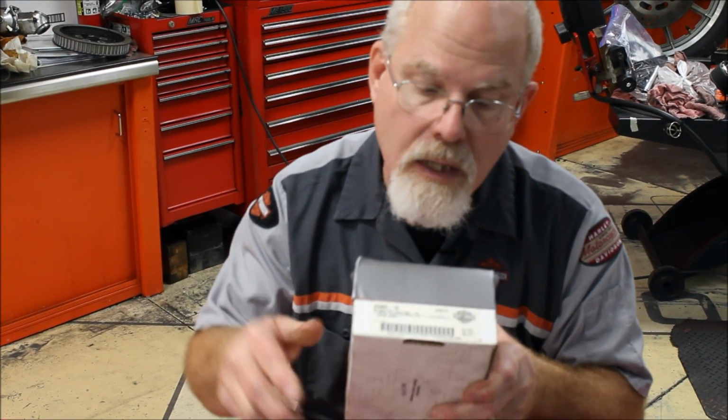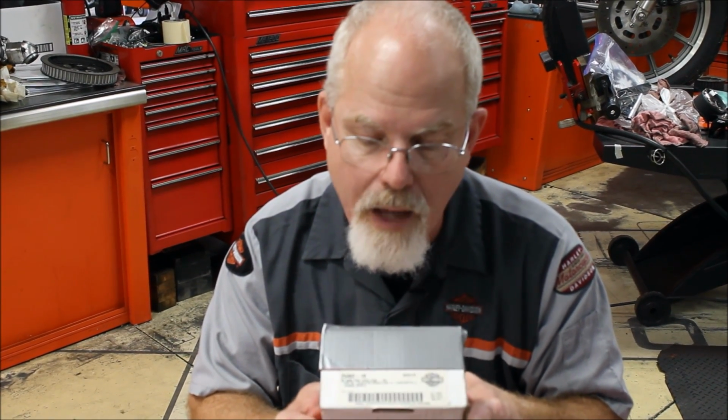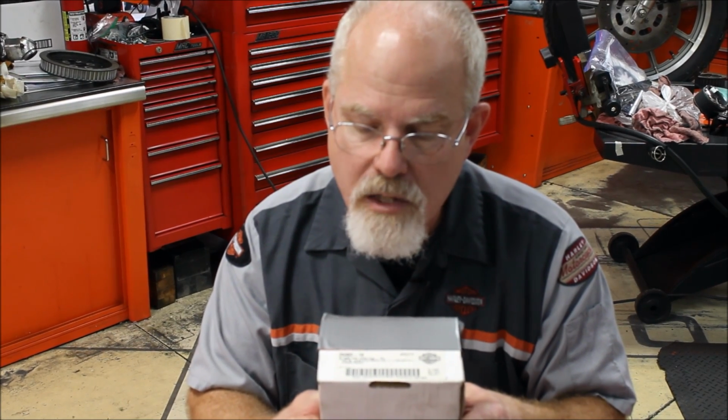The 259E cam you chose because you wanted more, and it will deliver more. It'll deliver more power than the stock cam and the 255 cam. It'll give more power in the mid to upper range. Now, to have admission to this e-ticket ride, you have to give a little bit more in cost and labor and parts because we want this motor to be as reliable as the stock motorcycle.